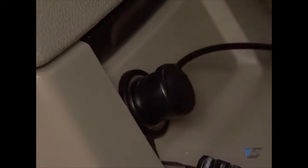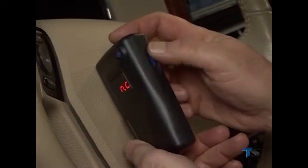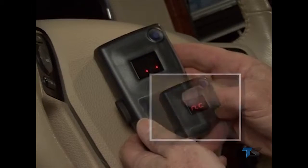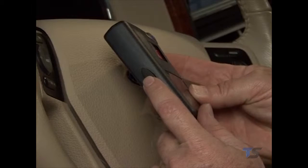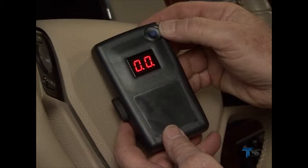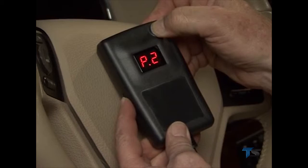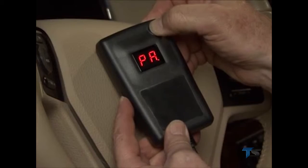After the engine has started, plug the handheld unit into any 12-volt auxiliary power port within easy reach of the driver or operator. Dial the power wheel located on the right side of the handheld unit downward to its minimum position. You will see either flashing zeros or N.C. in the display. Now simultaneously depress and hold both the manual override, located on the left side of the unit, and the boost button, located on the upper right-hand corner near the display. Once the two buttons are depressed, the display will begin a countdown starting with P5 down to PA. After PA becomes visible, the manual override and boost button can be released.